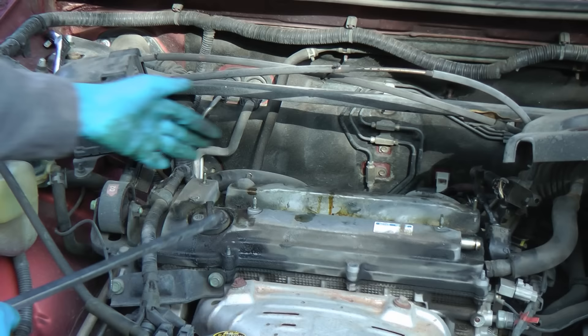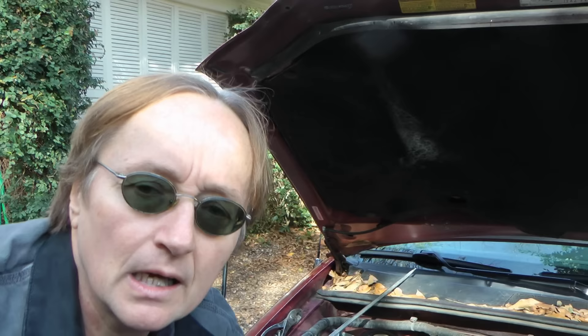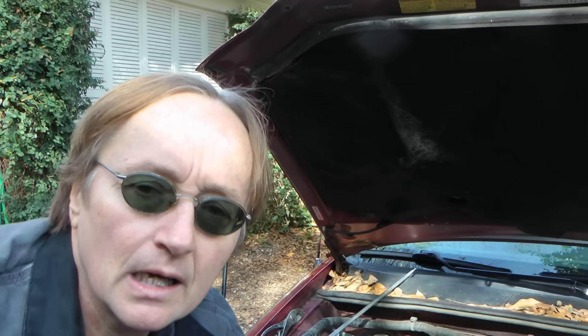It's a pretty easy job when it comes down to it. Once you take all the little bolts off, get the big screwdriver again. The valve covers are pretty stuck on, so find a little ridge like this and pry — then you can pry it off, and with a bit of wiggling you can get it off.